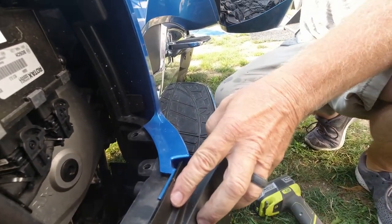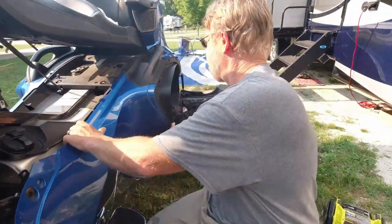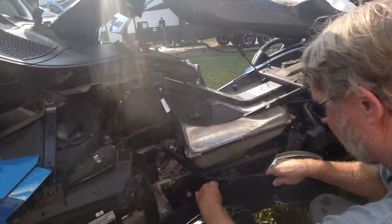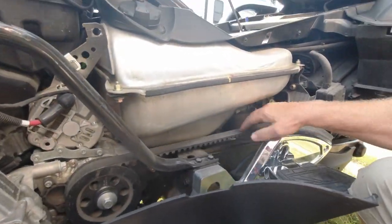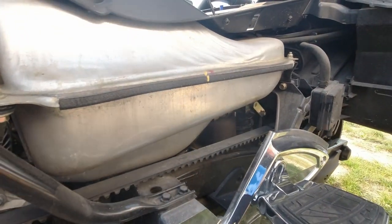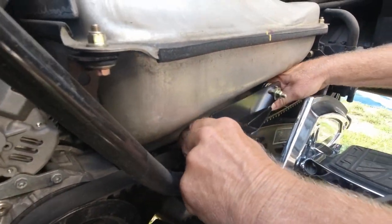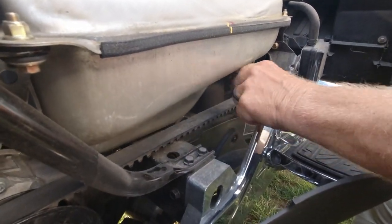So a shorty there and a shorty up here. This just lifts up off there — it had some clips where it slides in. This is the belt, and when you're going down the road you're getting this little vibration. I'll show you what this dampener is going to do — it's going to sit right here and hold that belt from fluttering going down the road.